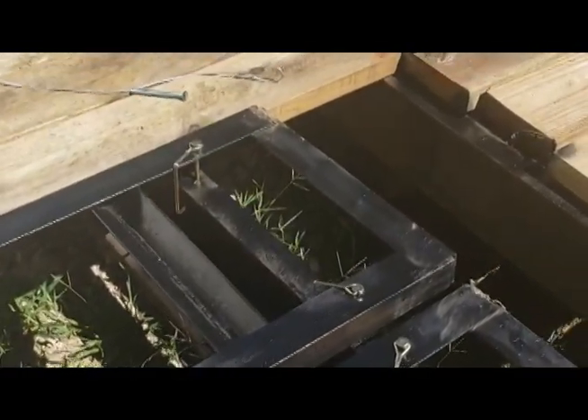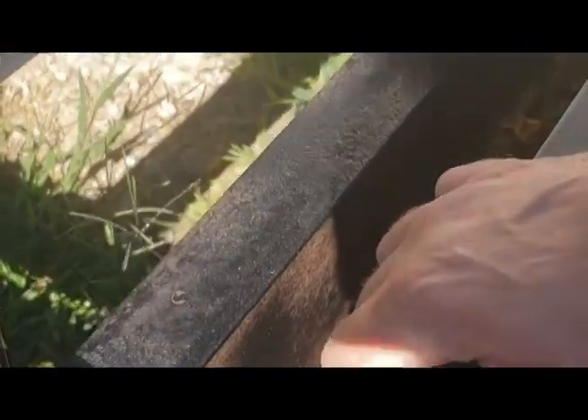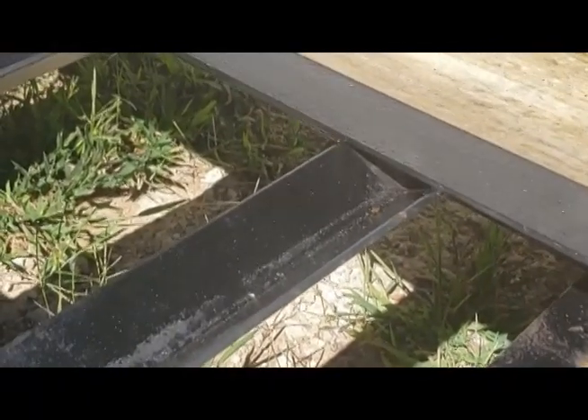This is future me to show you what I did wrong. Those pins are the incorrect pins for this type of application. When you're using a trailer and bouncing up and down the road, these pins will literally just pop right out. The right connection here would be something like a hood pin, or a bolt with a wing nut at the top. I'll correct that later but for now I'm just going to leave these in here to hold them in place.